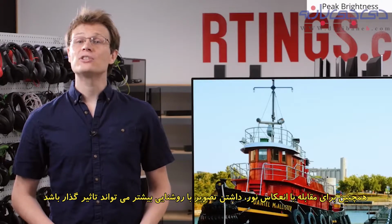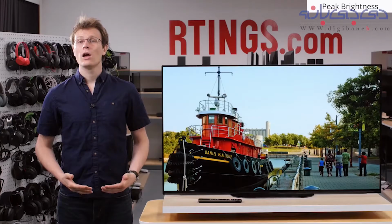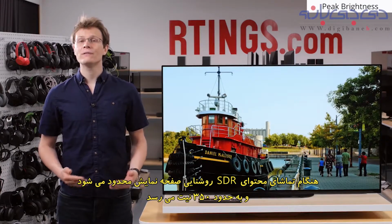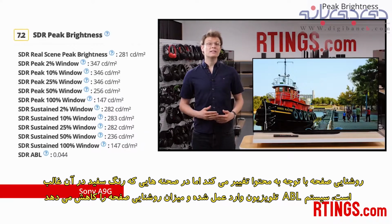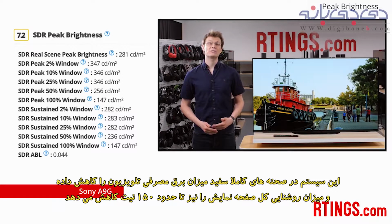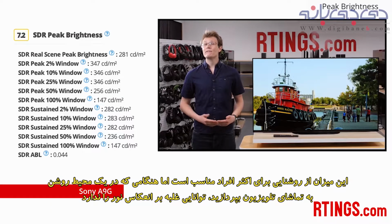A bright image is also important to counteract glare. When watching SDR, the brightness is limited to about 350 nits. As the brightness of the picture itself increases further though, like on our full screen white slide, the TV's ABL, or automatic brightness limiter, kicks in. This restricts the power usage of the TV and limits the brightness of the whole screen to about 150 nits. This is fine for most people, but in a bright room it may not be enough to counteract glare.